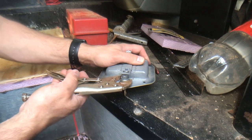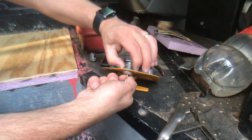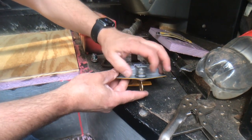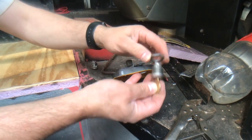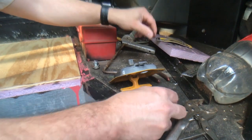I didn't grab the right wrench, but it's really easy to break that nut loose. Just hold your tumbler with the key and you can go ahead and unscrew this. Very easy repair. Then we can pull the tumbler right out — and there's that.